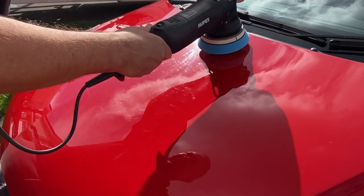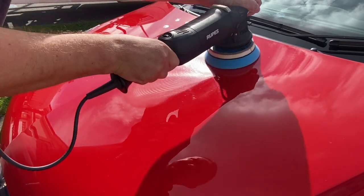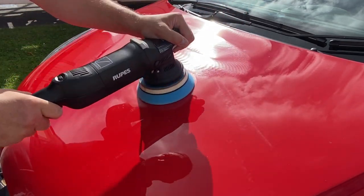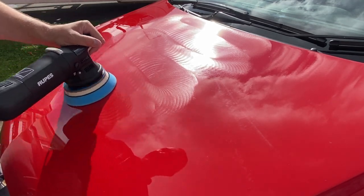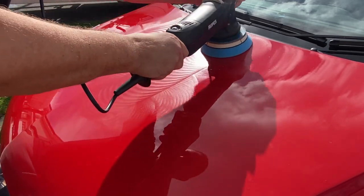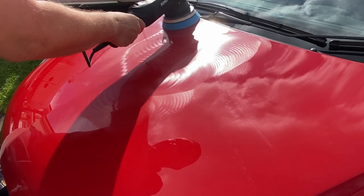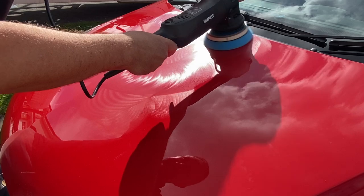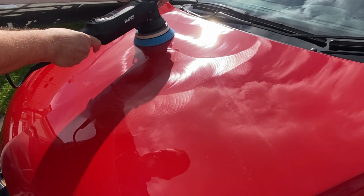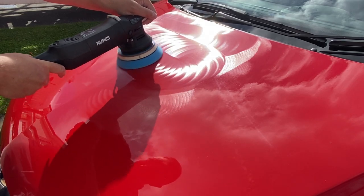This is quite a good angle to see the oils in the product and how well the dual action polisher spreads and works the polish around the bonnet. Even an all-in-one polish needs a pad clean after every set - I use a combination of a pad cleaning brush and a scrunched-up microfiber towel. Even with regular cleaning it can't unclog a pad, so it's a good idea to have at least four pads for a car of this size, or be prepared to keep cleaning the one you have. I'm only using this pad for the bonnet and the roof, then onto a smaller polisher for everything else.